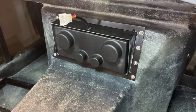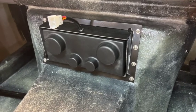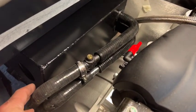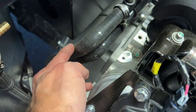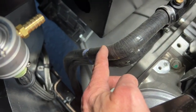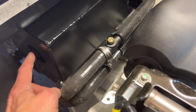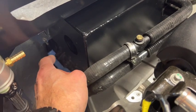There are plenty of other things to do. First up, I've put rivnuts into the fiberglass body and bolted the heater box on — four bolts on each side, nice and solid. On this side I've only temporarily connected the pipes so far. I'm going to make a small bracket off one of the 10mm threaded bolts in the head to hold the pipes and stop them flopping around — they're coming up really nicely, not hitting anything. I just need to fit my little flanges and go straight out into the bodywork.